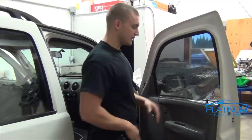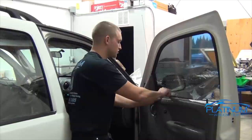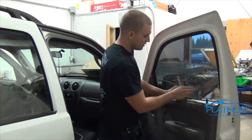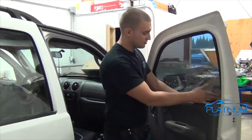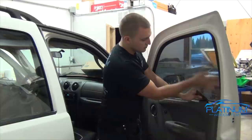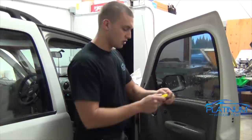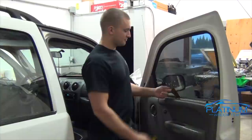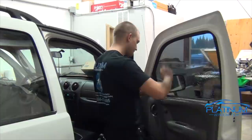Don't be scared to spray too much, but don't overdo it — all the water goes where rain would go, dripping on the outside of the glass; it does not go inside the door panel where the electronics are. Now peel the remaining clear release as you slightly spray. With the film laying like this, take your Easy Reach Gold or Easy Reach Platinum — pull your front corner away and then pull the gasket away. Since we've already shrunk the film on the outside, it's going to lay very nicely on the inside with not much shrinking needed. Pull the gasket away as you slowly work the tint into the bottom of the gasket. Make the film as smooth as it can be against the window before you touch it with the squeegee. Always wipe your blade and squeegee downward. Use the Easy Reach to keep it in the gasket, pulling it back and allowing the water to flow into the door panel and out onto the ground — this will reduce the risk of fingers popping up that may need to be shrunk.